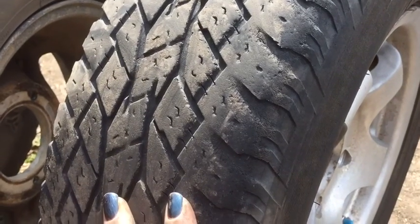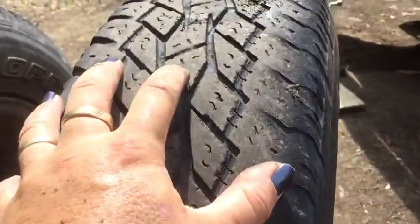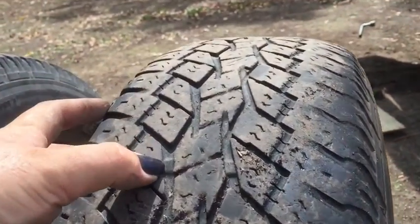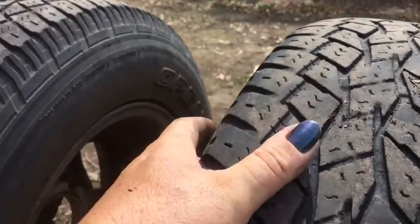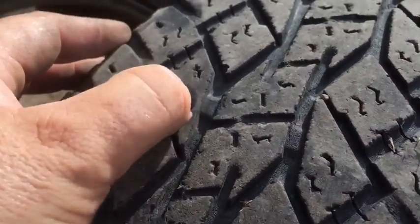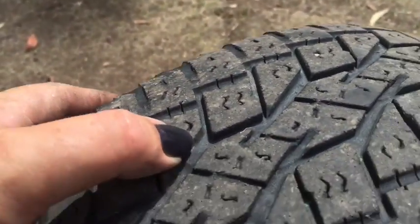In the next couple of weeks I'll get some more tyres anyway, but this should do the job — just changing them around a bit. This one's getting pretty low, the limit lugs are there — you can see that wear mark. As opposed to this one here, which has got probably about an extra 1-2mm, and then this one over here has got pretty good tread still.